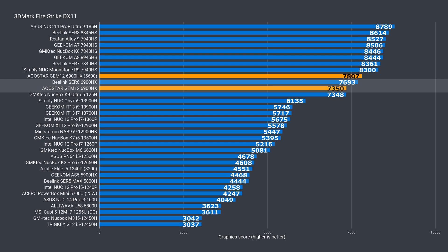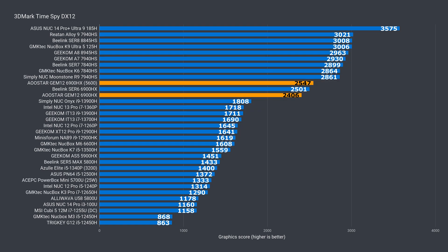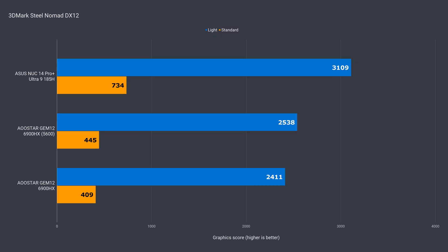Switching to performance mode didn't improve the graphics score. I can only speculate it's something to do with the RAM, which might have worse timings at 4800 than the other unit tested. Luckily, you can easily overclock the memory on the Gem 12. I just went with 5600MHz, which helps the Gem 12 come out on top — a 6% gain over 4800. The DX12 graphics benchmark shows the same story: 4% behind at stock, and a 6% jump when setting memory speed to 5600.